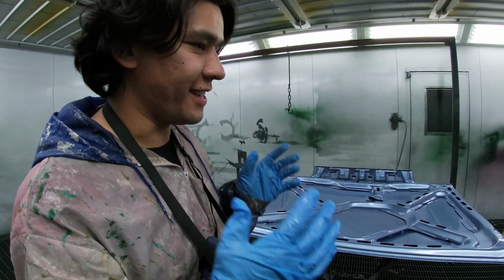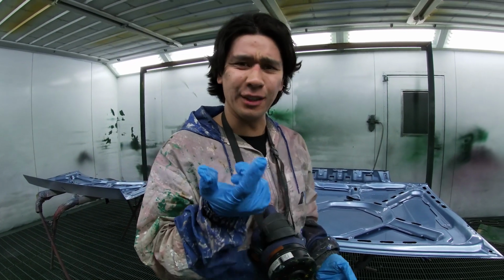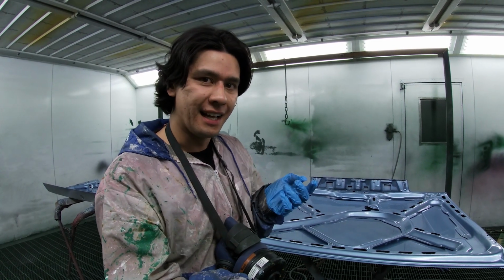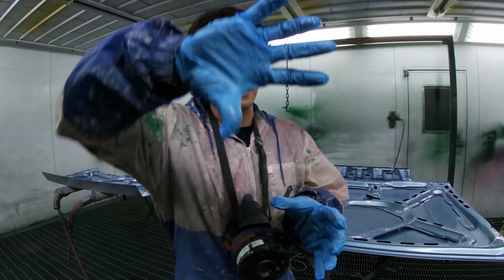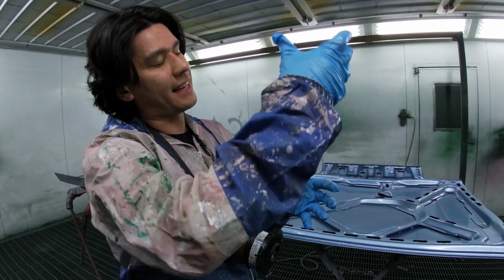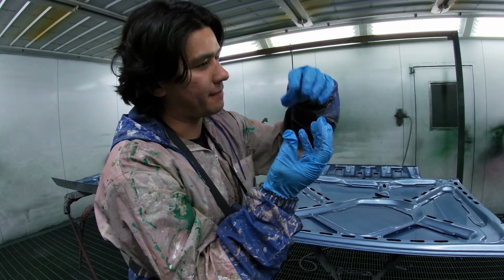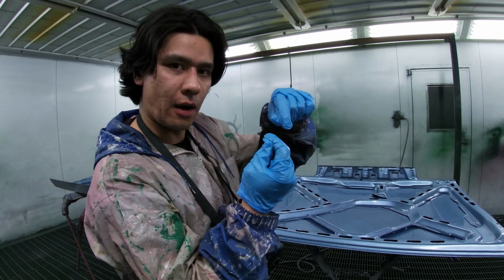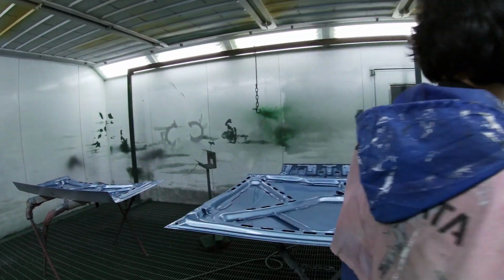So first coat, you could see that I got quite frustrated. I saw something in the corner of my eye. It looked like a droplet of clear coat had fallen from my gun. And it was the case, because it happened again. I got really frustrated. So the, what do you even call it, the cup that sits on the gun, it's obviously not a very snug fit. It happens. So what I quickly did was I went outside, I put tape around where you attach it to each other, and then it was okay after that. I managed to save it.